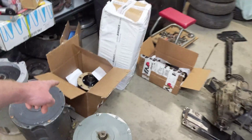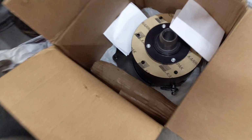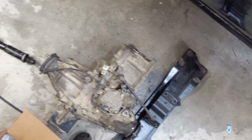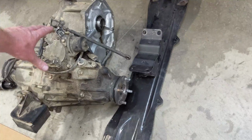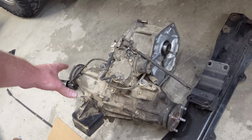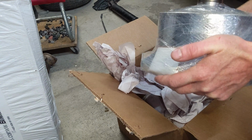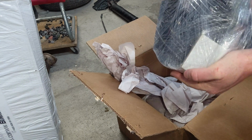All right, working on the EVJ80 again. It's transfer case day. We got my black box in. So this is the doubler. That's going to give us a 2.7 to 1 further reduction to get electric motor RPM in the perfect range. But we have to split our transfer case or open it somehow to get the new shaft in there. Then also this is the transmission mount, and we have to fabricate a new mount for this whole assembly, and also on the rear, so that we can bolt it into the truck without having the original motor and transmission. It's maybe 50 pounds, not super heavy.